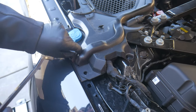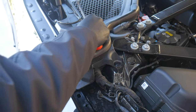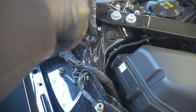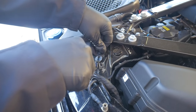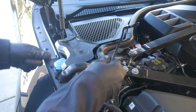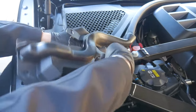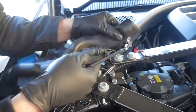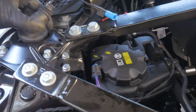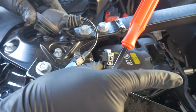Next, move to the top of the engine bay where you'll see a bunch of pop tabs. Tyler is using a handy little tool to easily pop them off. Remove the plastic cover — there's also a locking plastic tab you twist counterclockwise to unlock it, and it's even labeled. The plastic covers will basically just pop right off. Once removed, take off the EDC sensor on top of the strut by pushing down on the plastic tab and detaching it.